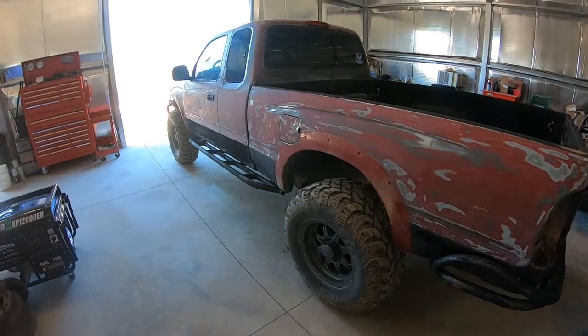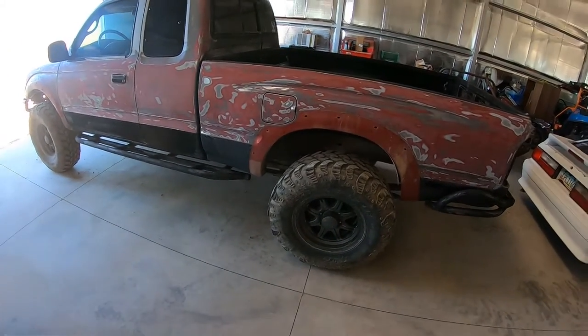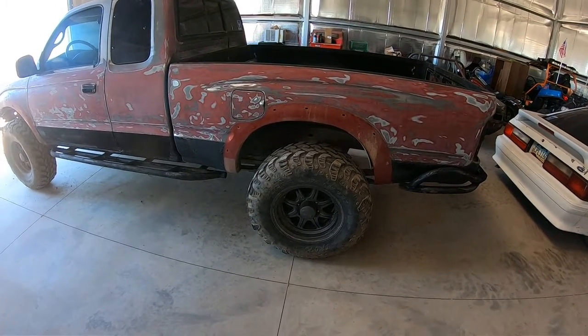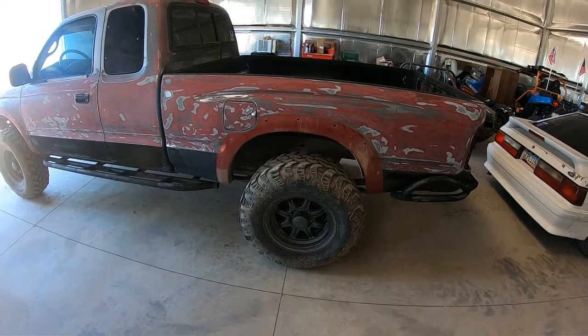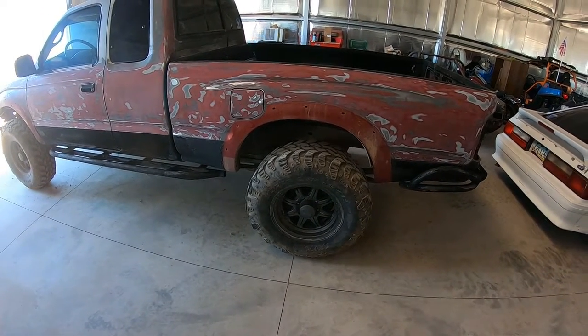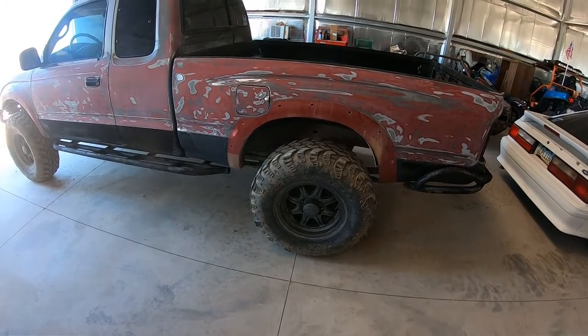I went back over everything with 220 on the last video from the 180. Don't know if I'm going to need to go over it with 320. If I do, I'll do it by hand. I don't think I'll need to do that with the DA sander again. It's hard to get in a lot of spots with the DA sander. But today I'm going to hit the fender wells areas with the DA because it's just quicker. All right, and that's what we're going to do.